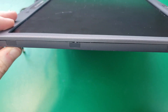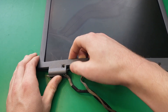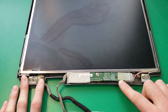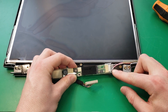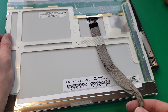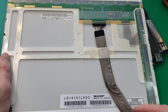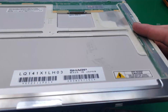The last thing to do is take apart the screen. We remove screws located underneath little stickers and it comes apart pretty easily. This board is the driver board for the fluorescent backlight — since this is a really old screen, it uses a fluorescent backlight rather than an LED backlight like newer laptops. The high-voltage connector goes to the fluorescent tube, and this black box is a transformer for stepping up the voltage. On the back we have the data cable, the row driver board, and the column driver board, which work together to coordinate the pixels and create a picture on the screen.